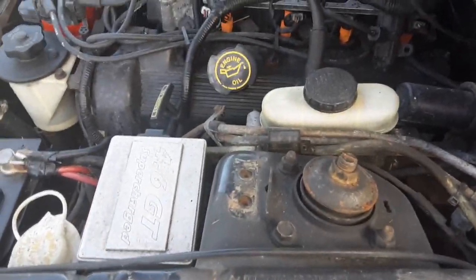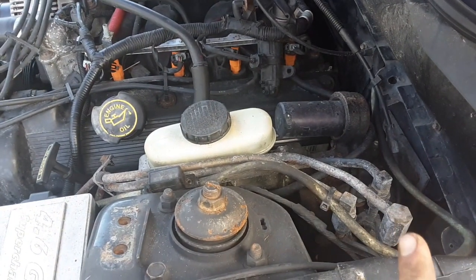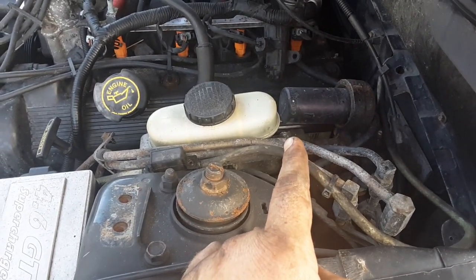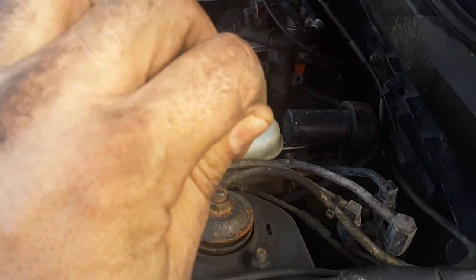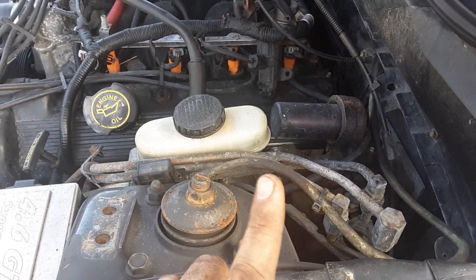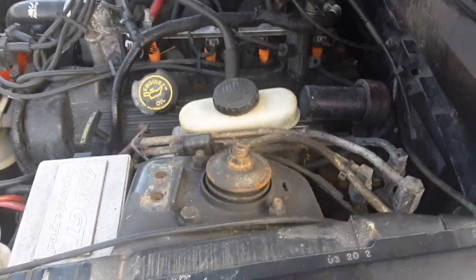Now, when you put the headers on, the way this very last one comes out, it comes out and up, okay? Well, you can get to the bottom through the header hole. The top, you cannot, and it is a pain. I had to go underneath the header between that and the head and have a wrench and barely a little bit at a time to tighten it. Same with the bottom. There is one on the bottom right below that one where you can barely get the wrench up in there. It takes time, but it's worth it in my opinion, especially since I got these on trade.